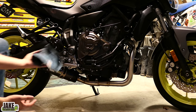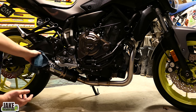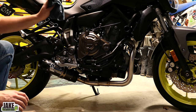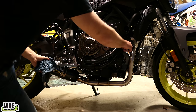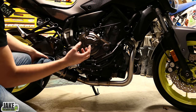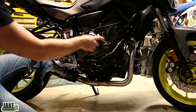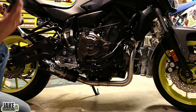The way I like to check for leaks is to take a rag and hold it over the exhaust end. You don't have to smash it — you're not trying to completely stop the exhaust flow. You're slowing it down and forcing pressure to places that could possibly leak, and also muffling it a little bit because it's going to be pretty loud. Places it might leak: up by the exhaust headers is the first place to check — put your hand up there, you can feel hot air or usually hear it. This area gets hot really fast so check there first. The next places would be this mid-point connection, and if it's fine at those places, we're good to go.